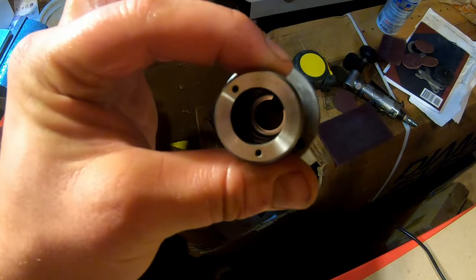With the nozzle, if all the stuff doesn't come off in the sonic cleaner, just Scotch-Brite that tip. And I found that you want to make sure, I mean, these holes are so small. I don't know how this truck even ran with all this carbon on it. But one thing I noticed: if you put some brake cleaner in there, it's going to drip out, and then if you blow air into it, I don't know if you saw that, I'll do it again. The stuff blasts out those little holes and lets you know they're all clean. Pretty cool. All right, we got all our parts blown off, clean, ready for reassembly.